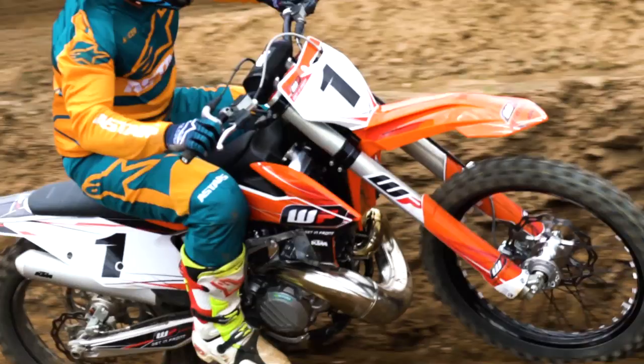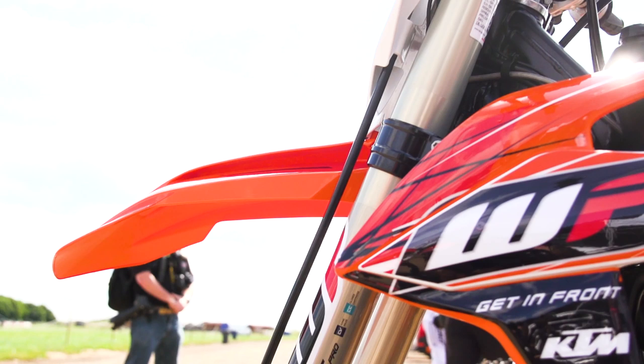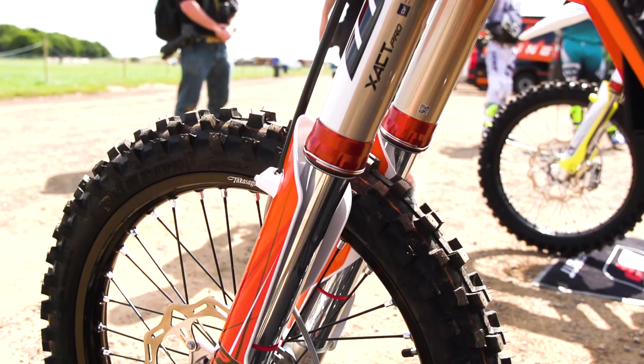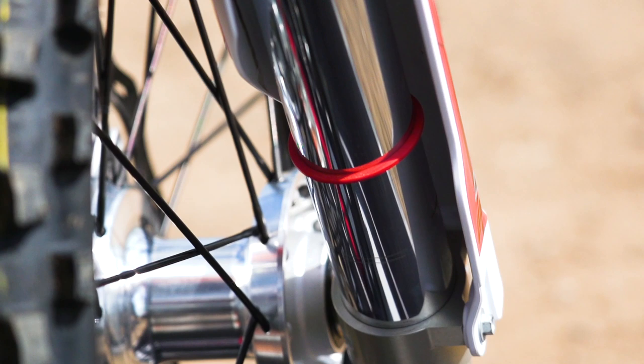My name is Matte Felt. Starting on the front, basically the length of the fork is 5mm longer, plus then 5mm more stroke. The damping system is basically the same as on our older version, but we have a lot of small updates on many parts, especially on the cone valve system. We have a new piston design, and then if you move up towards the compression unit, we have a different length of the pressure cone rod, which basically creates more plushness and comfort for the rider.